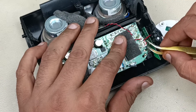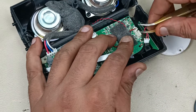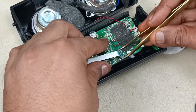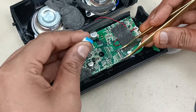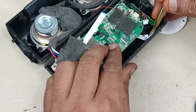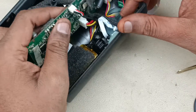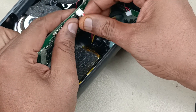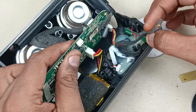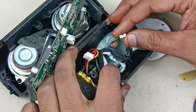Now I am going to remove this NFC. This is the mic — not required to remove. This is the main flex cable, just taking that out. This is the battery indicator's flex cable — taken that out as well. Now just by pulling like this, the back side access comes. Now we can remove this auxiliary cable, Bluetooth antenna's cable, the battery cable, and the charging cable.